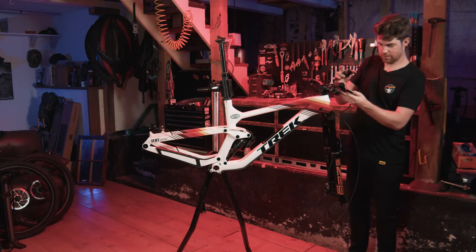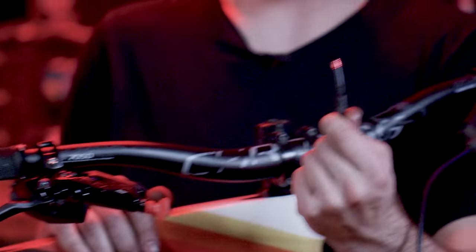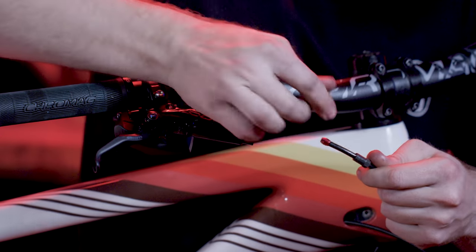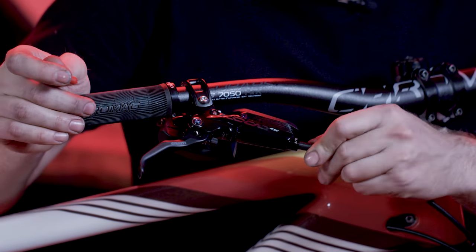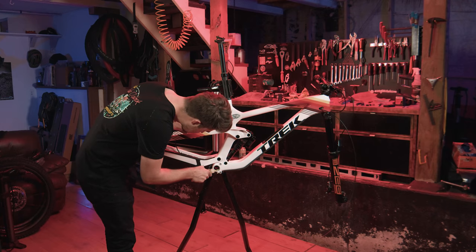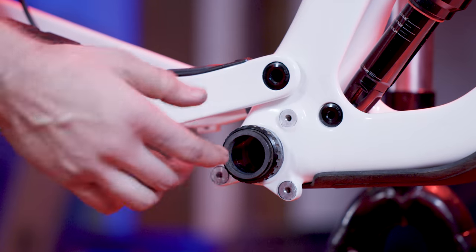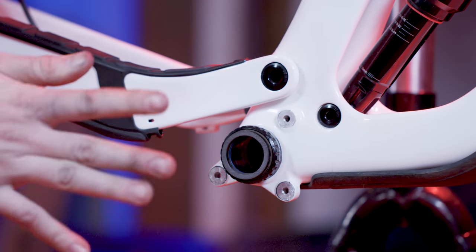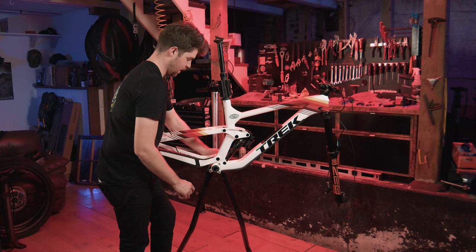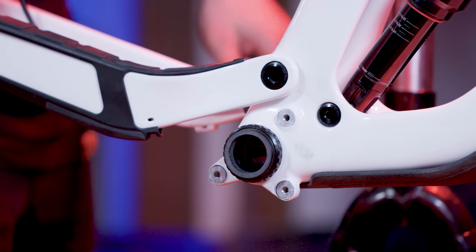Boom — there we are. The measurement looks great. We have our cable end and it is ready to install. We're going to gently pop off the lever plug, that goes in there, and this threads in. We're going to prep the bottom bracket area with some lubricant — get those threads nice and juicy. For the bottom bracket on a threaded frame like this one, your drive side is reverse threaded so you tighten to the left; your non-drive side is normal threaded so you tighten to the right.